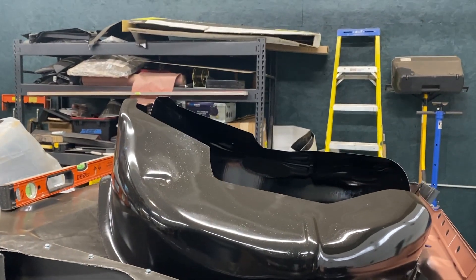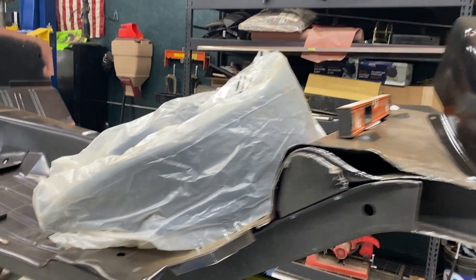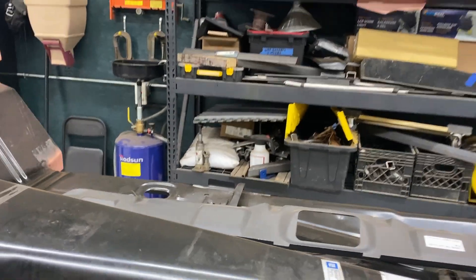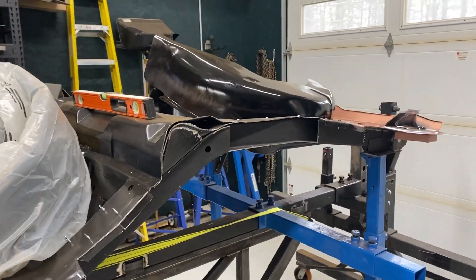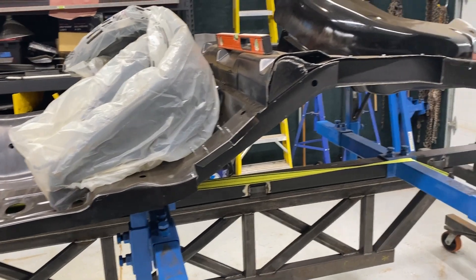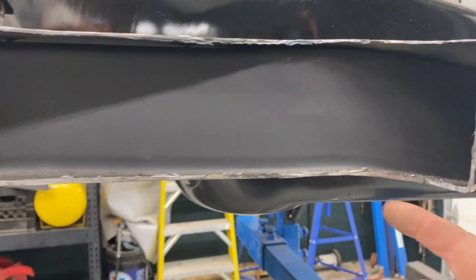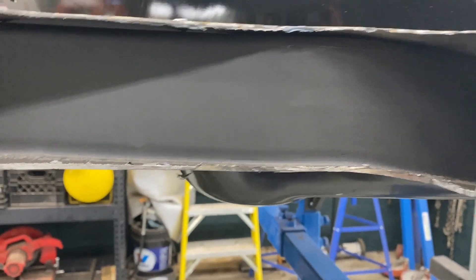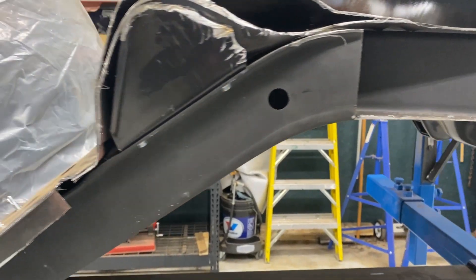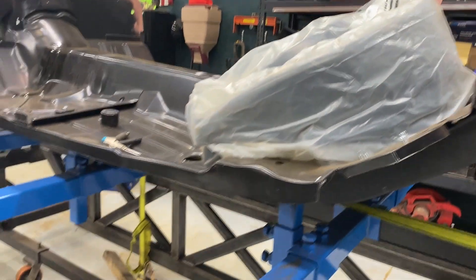I did prime the mini tubs so they wouldn't rust — they've been sitting around for a while. The outer tubs and the rear valance pan are in here too, just got those out of the way while cleaning. That's where the fun begins today. First thing I'm going to do is take the Detroit Speed template, put it on the bottom of the frame down here, and make sure I'm cut back far enough and there's no constraining point there. I'll talk to you again when we're ready.